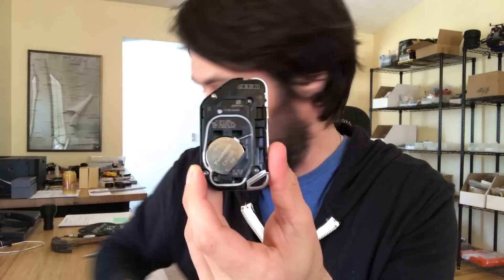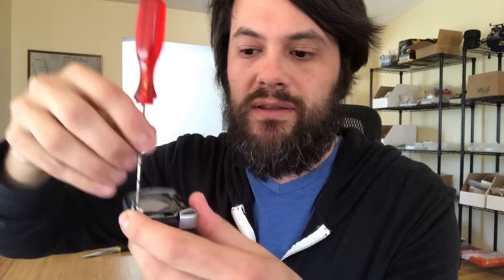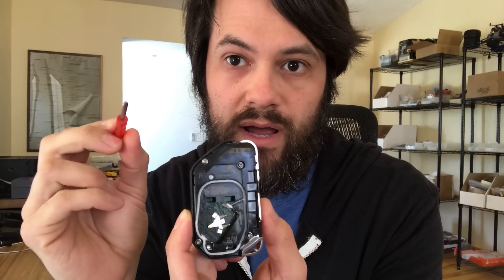This is what you're left with after that. Next, remove the battery — there's a little spot right there where the screwdriver comes in and the battery comes out. Save the battery unless it's dead. Then there are four small Torx screws to remove. When you buy our case, we include a little T6 Torx screwdriver to remove these, so just go in and remove all four screws.